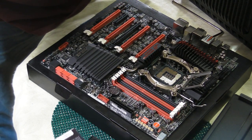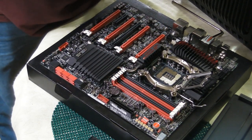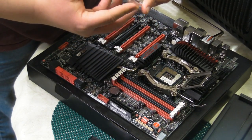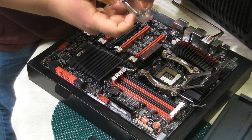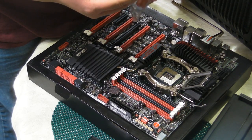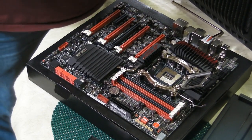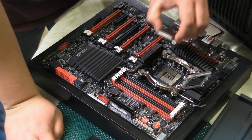This is still in the plastic case. The inside of it should be nice. And you'll notice that the heatsink has a mirror finish on the bottom of it. You can make it even better by a process called lapping the heatsink. You shouldn't lap the CPU itself though, because that could damage the CPU. Although I have seen people do it successfully, I do not recommend it. Lapping the heatsink requires some skill and a lot of time, in some cases, a beer.